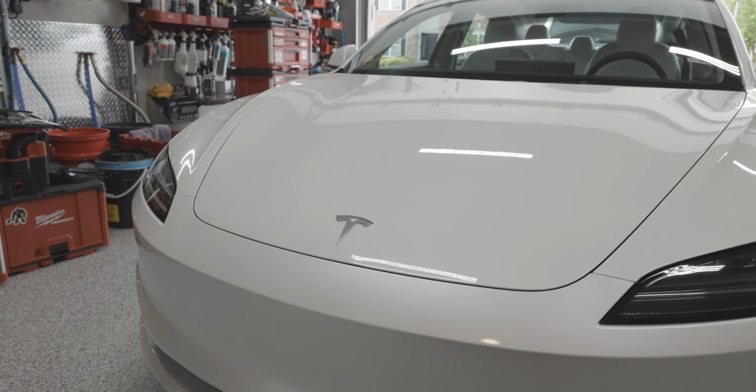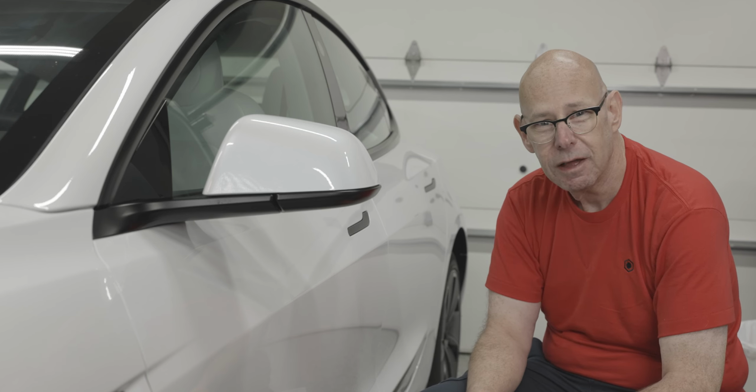Overall, I would tell you this is super easy to apply, but here's the key. You have to make sure that you are leveling right away. You do not want to allow Stout to dry on the surface because it's really stout and you will have a difficult time removing it. So plan your space accordingly in terms of what you're going to cover and coat, and then how quickly, so that you can get back to level, rather than some of these coatings that have 1, 2, 3, 5, 10-minute flash times where you can coat a much larger area and then go back and level. In this case, you can't do that because you really need to level immediately.